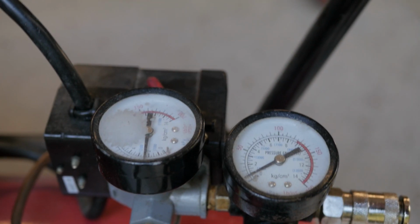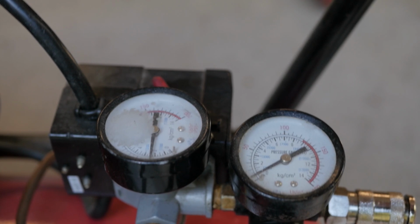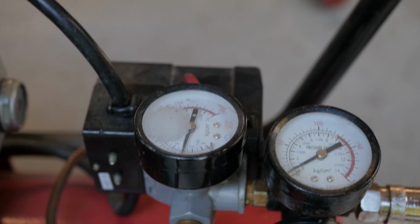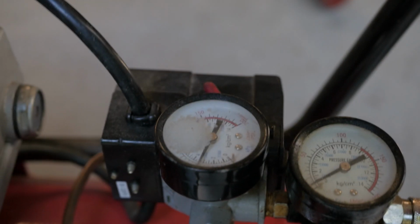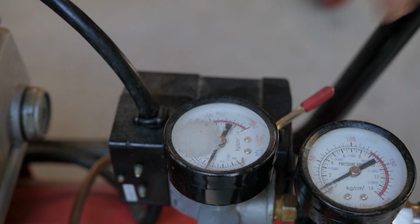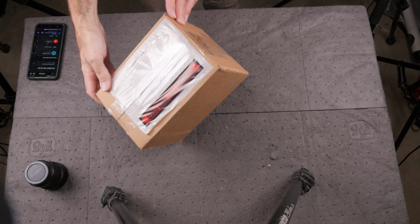Normally my air compressor will build pressure from 0 to around 110 psi in about 2 minutes. At the point where I put my finger on the gauge to show it had reached about 30 psi, the compressor had been running for about 10 minutes or more and it never went higher. Also, the sound is different. I'll come back to that later in the video wrap-up.